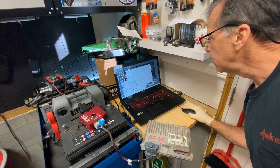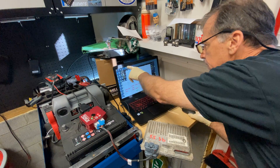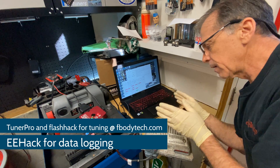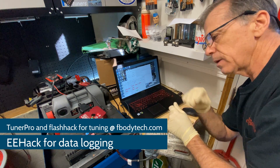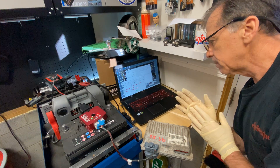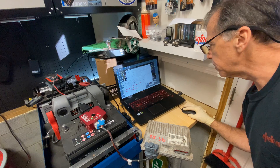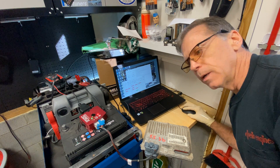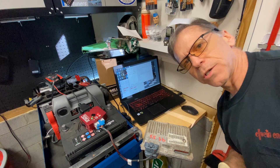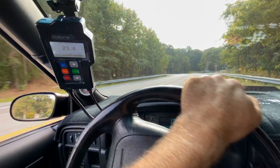Really, there's TunerCat for OBD1, FlashHack, and EEHack — check them out. I really, really like FlashHack and EEHack, and this is for OBD1. My computer died that had Datamaster — I really liked Datamaster because it was all on one screen, showed you anything you wanted condensed in a graphical way. But they don't support Datamaster anymore and my license is long gone. I'm going to be an EEHack connoisseur in the future — whatever I learn about it, I'll try to let you know.